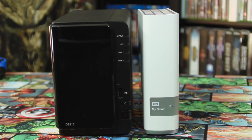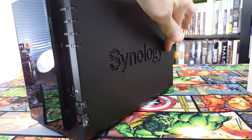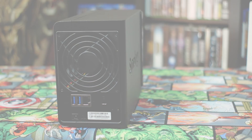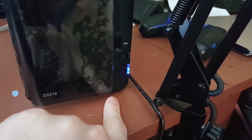Here we have a black box that's roughly the size of two of my WD MyBook Live drives. Matt black covers the entire box aside from the front panel, which is a glossy black — I'm never a fan of glossy plastic, but this isn't the worst implementation of it. On both sides of the device we have a Synology logo which also acts as a slotted vent for the internals. The bottom features the specs and an FCC sticker, a couple more vents, and four small but effective rubber feet. The back features a 92mm exhaust fan, two USB 3.0 ports, a Gigabit Ethernet port, a Kensington lock, and the DC power input. The DS216 is capable of wireless connectivity with a dongle, but by default it simply connects by Gigabit LAN, which will get you the best performance anyway.